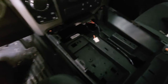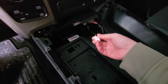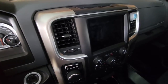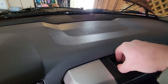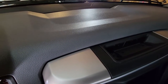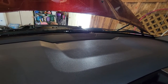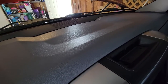This just has a little clip that goes on the inside of that 12-volt receptacle. And then there are three T20 type screws that need to be taken out. There are two up here in this little cup receptacle. That takes the star bit — the T20.